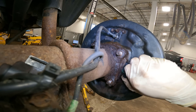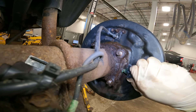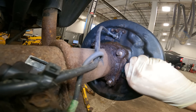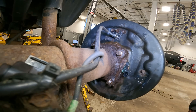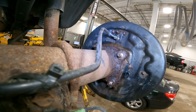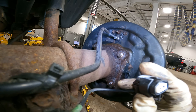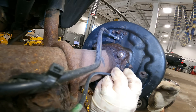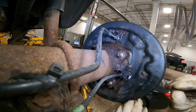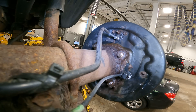The sensor is going in. The ring is in there — very good. Now that we have our sensor in, always double-check your connector for any corrosion. We're in there. Now we're going to test operation with the scan tool.